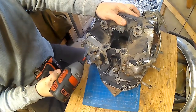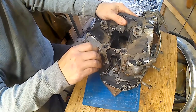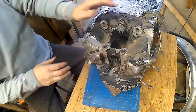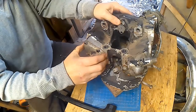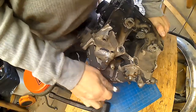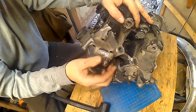I'm going to start by taking off the cam journal. I'm on the intake side here — intake side is a little easier than the exhaust side. There's four screws here and then a nut that's fourteen millimeter. Of course, I just realized I forgot to take the nut off. This is the rocker arm shaft, and you can pull these out with it still attached, but it's easier to do without.